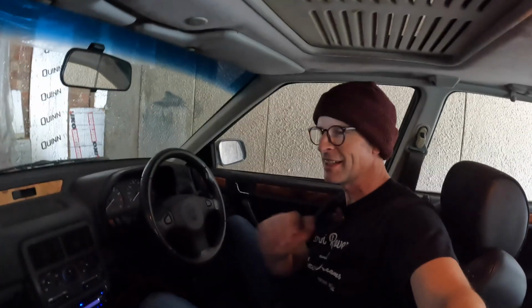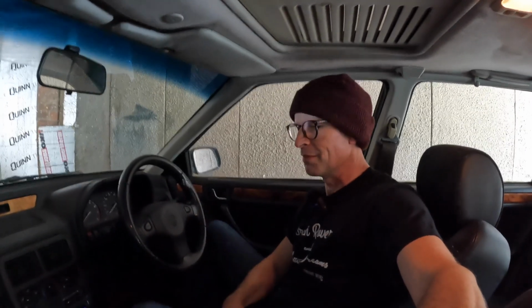Better and better. Right, so this is fantastic news for 3 reasons. First of all, I've now got functioning taillights on this car, so I can take it and drive it. The thing is MOT'd, they just weren't working. Secondly, it was a really cheap fix. Even the replacement switch would only have been a couple of pounds, but I'd kind of got into my head it was a more serious problem. And yeah, it's just fuses. Who'd have thought it? Because I'd checked all the fuses a couple of times and they were checking out fine. So the fact it was just bad fuses, which is something I've really not encountered before, is a bit of a freaky miracle, but great, it's done and fantastic.